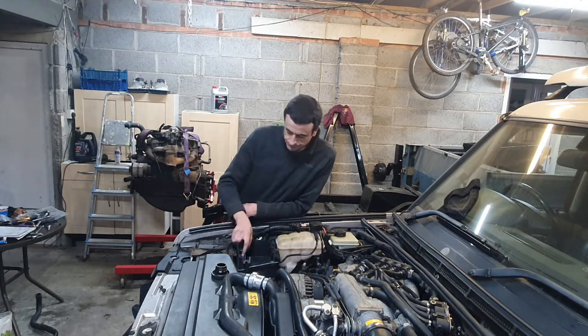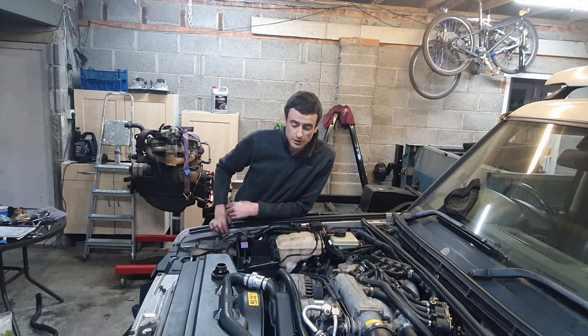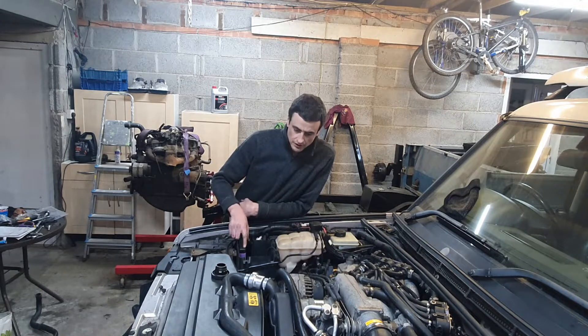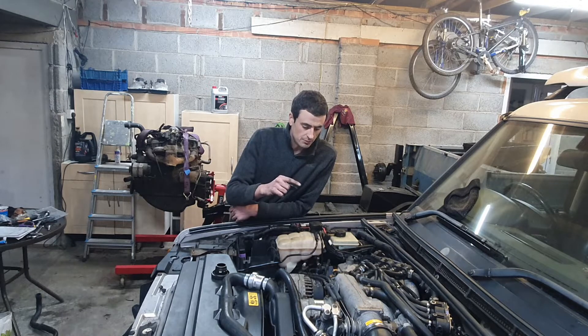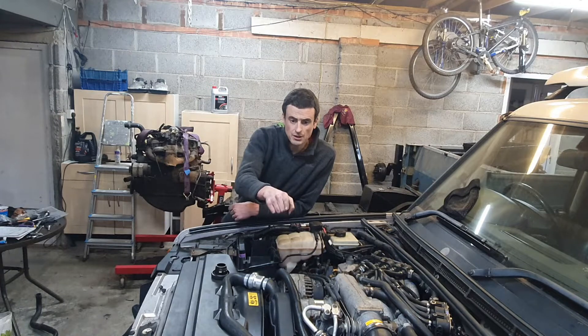I'm going to fill it up with oil. I'm going to leave the LPG ECU disconnected, so that intercepts the signal to the petrol injectors — so it won't even try and fire up. The plugs are out, so I'm going to spin it for a period of time. I've already done this on the engine stand just to prime it with oil again. The radiator is empty. I've got this high zinc content oil to go in now for the first few hours of driving. Then I'm going to fill up the coolant, put the spark plugs in and leads on — and then start it up. Oh, and some power steering fluid.